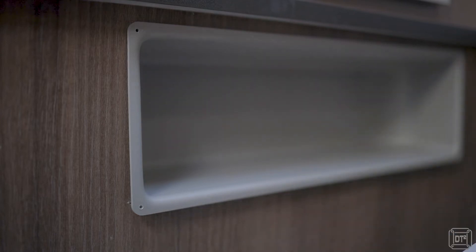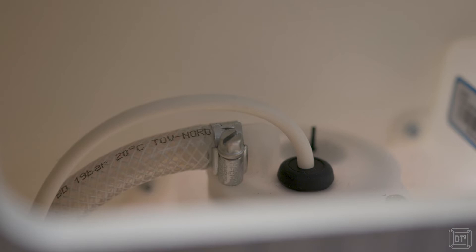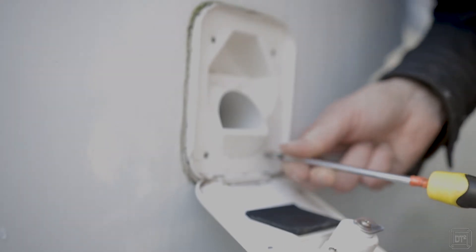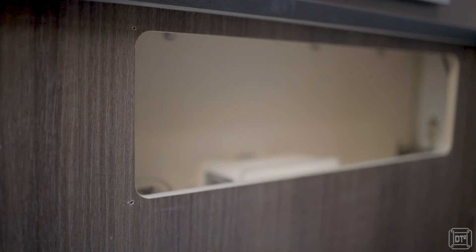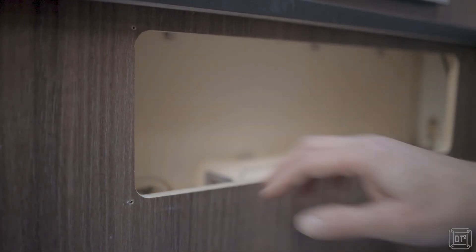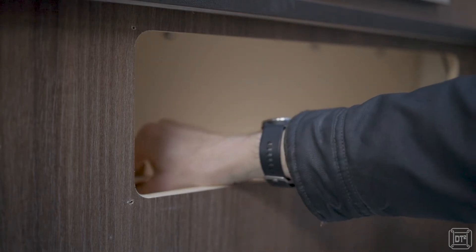Section number six on the instructions is not applicable for certain models — it appears to be applicable for mine — and it was to disconnect the water hose, but from the outside I couldn't see where it was. Now in our van above the toilet we have this: you can see this is the flush tank and this is the water connection hose to the flush tank. I think that means the previous step where I unscrewed the four outer screws is actually incorrect for this model, even though it quite clearly says for this model to take them out. The flush tank here is completely separate from the toilet module, only connected via a hose. What I do need to do is disconnect this hose because it's connected to the toilet which is going to come out shortly.